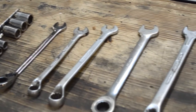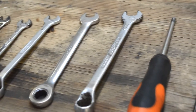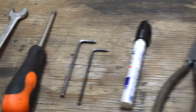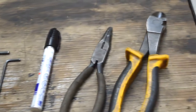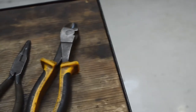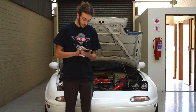You're going to need two 10 millimeter spanners, one 12 millimeter spanner, one 13 millimeter spanner, one 14 millimeter spanner, a star screwdriver, a size 4 millimeter and a size 3 millimeter allen key. I'd recommend taking a marker just so you can label things, but you don't need to. Long nose pliers and possibly side cutters.